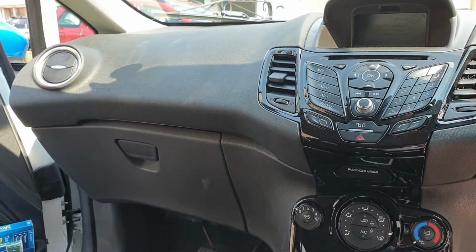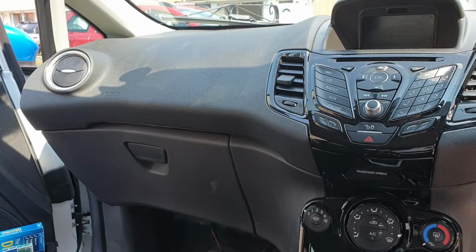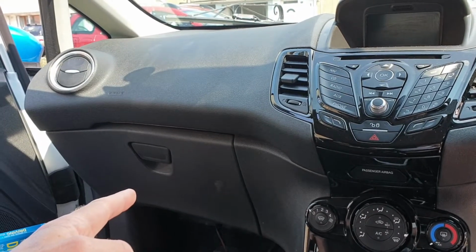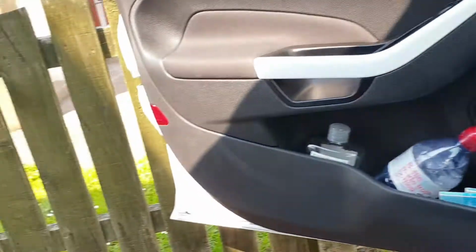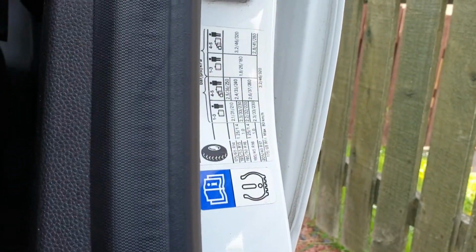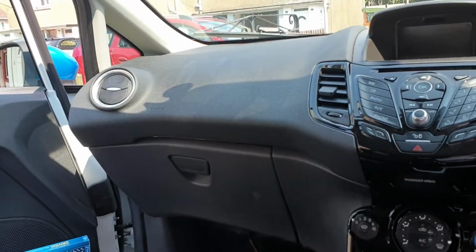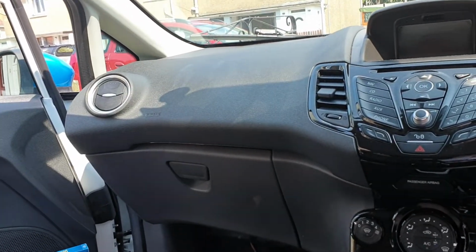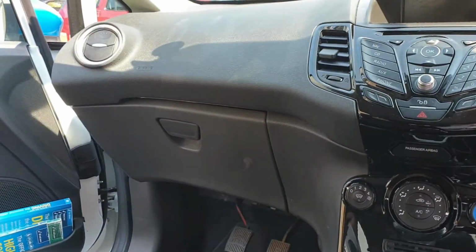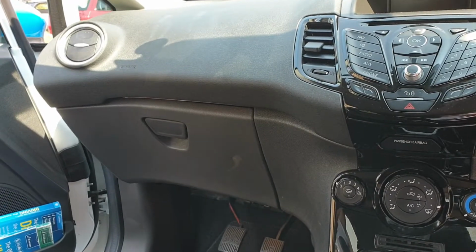So one of the questions could be about your tyre pressure, which you would find in the glove compartment in the manual. You'll also find it on the edge of the door on both sides, a sticker for your tyre pressure. Also your tread depth should be minimum 1.6 millimeters. Recommended is 3 millimeters, and that's across the central 3/4 of the tyre.